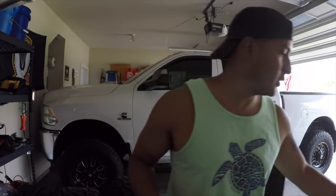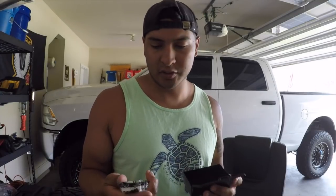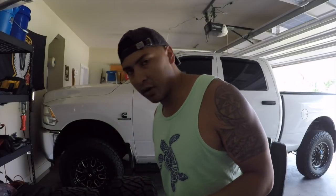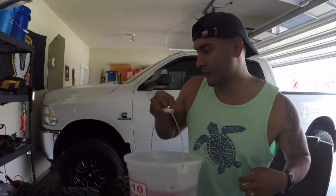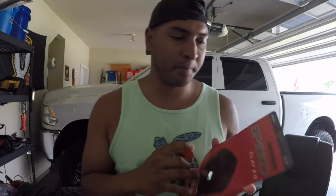After you wash it and dry it, make sure there are no other contaminants - grime, tar - really sticking to it. So what you really want to do is clay bar it. I'll put everything I'm using in this process in the description below. I've had this clay bar for quite a while, I've actually clayed it before when waxing it. But I also picked up one of these speed clay tools - it fits pretty good in the hand. I'm using some Griot's car wash in there as a lubricant while clay barring.